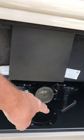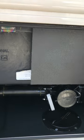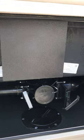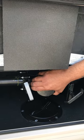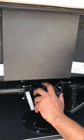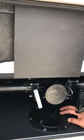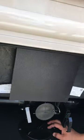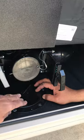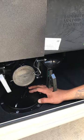Now, do you do the black tank and then flush water through it before you do the gray? Because your gray is going to flush the hose out. It's coming out in the same hose. Okay, great. So that screws off. There's teeth on it. And then your other thing will screw on there. You'll run your hose up and then into there. So it's going to come through here? Yep. It's going to make that curve? Yep. And then that's it.